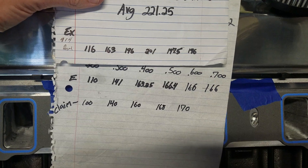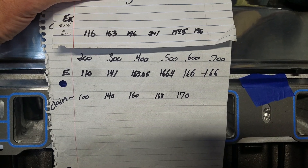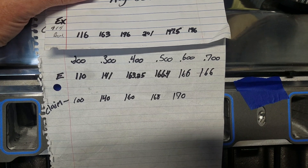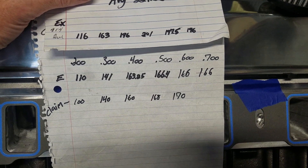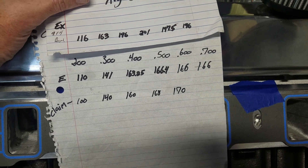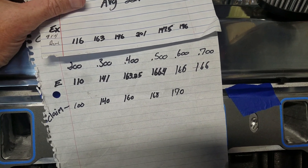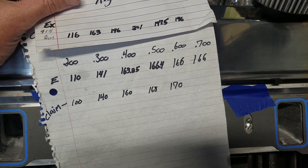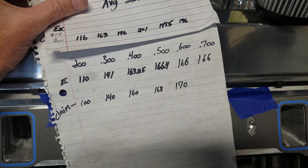At 300 thousandths we were at 141 out of the box, now we're at 163 — and this is really where I wanted to improve the most, the exhaust portion. That's 22 CFM at 300 thousandths. At 400 thousandths we're almost at 200 CFM already at the new levels; before we were at 163, now we're at 196 — so it reaches these numbers nice and fast. At 500 thousandths we did 201, and before we were at 166 which was the top point. That's roughly 35 CFM better now that it's ported compared to out of the box.